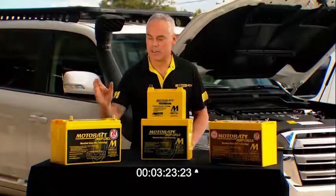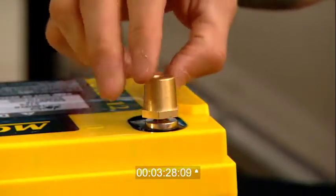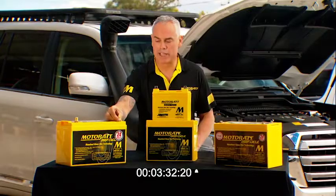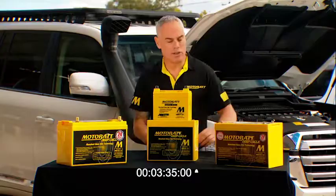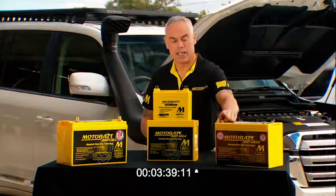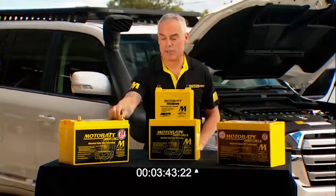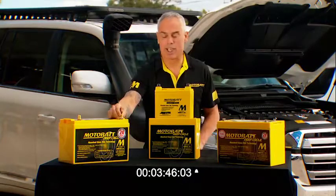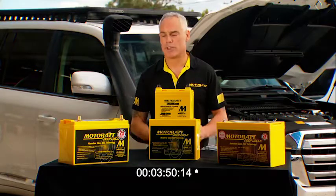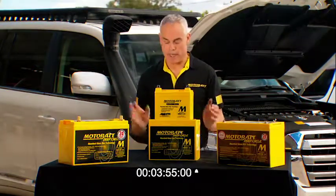Terminal designs. All the batteries are shipped with multiple terminal designs. So if you're using your standard car automotive type connector, you can simply screw down to the nutsert here. You can also just bolt directly to the nutsert, as you can see here, and you can also take this little guy, double it up on the top of here for any of your auxiliary applications, okay? We also manufacture these with a standard marine style terminal for those who want to have the twin post setup. Just don't have one here today to show you.